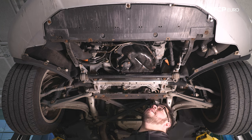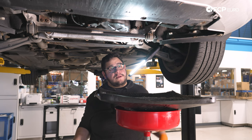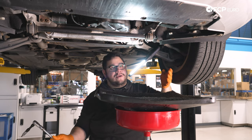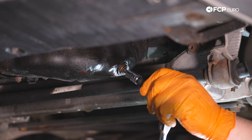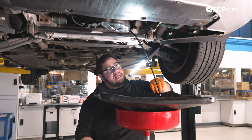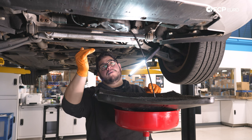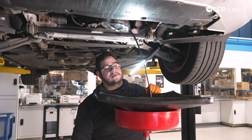We are under the A4 working on draining the oil. We have our six-millimeter hex equipped on our ratchet and our pan situated so that the angle of the oil will be caught and then slowly center itself back underneath the pan. We have the oil fill cap off just to allow it to breathe, break that vacuum seal, and let everything flow a little bit easier. We're going to give that as much time as it needs to drain. While we're working on that, we're also going to work on removing the three 10-millimeter nuts that hold our oil level sensor in place — that's going to have to come down in order to pull the oil pan out sideways.